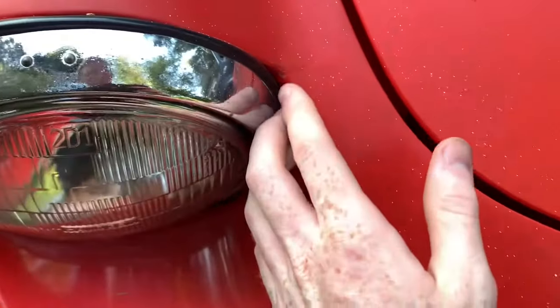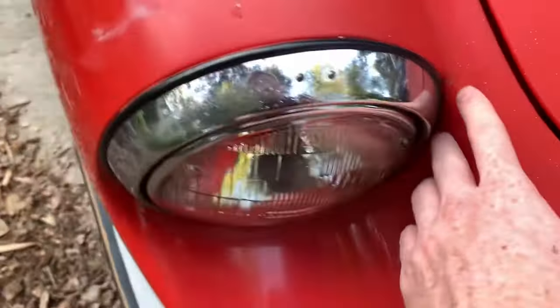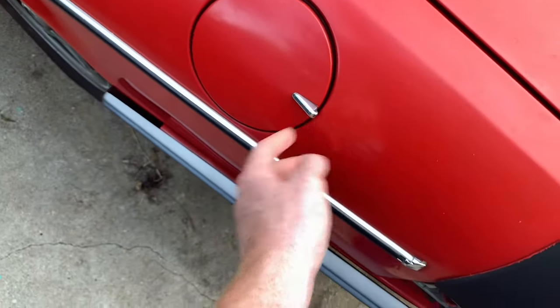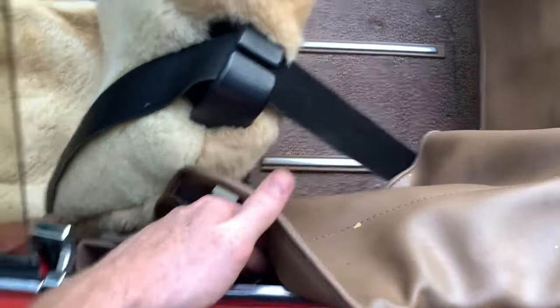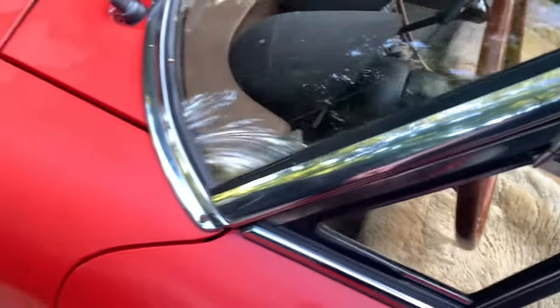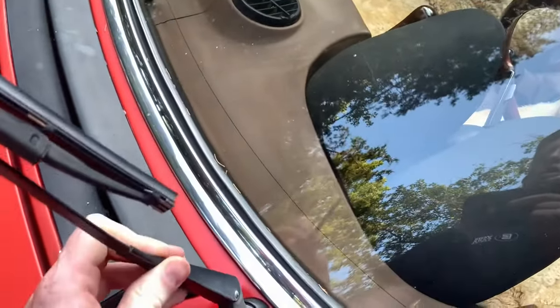There are a few things you want to avoid whenever you polish. Cracks in your paint or slight chips can really mess you up — the polisher will completely tear off the paint and leave you with a giant unpainted area. Along where the panel meets the spoiler, that's another tricky area. You want to avoid anything that's not painted: spoilers, polished aluminum, chrome, plastic, leather, and the soft top especially. If you get any compound on the top, that's going to be really bad for the car. You can clean it off with time, but you want to avoid it as much as possible. I'll just tape off the areas I'm not going to polish over.